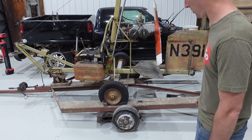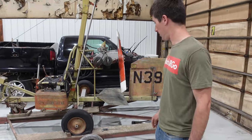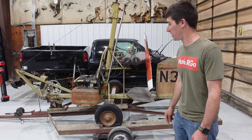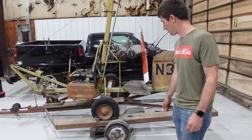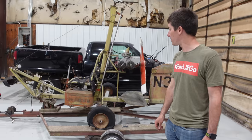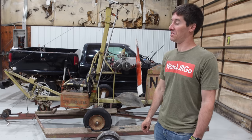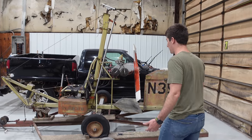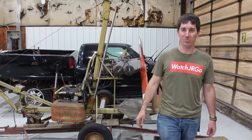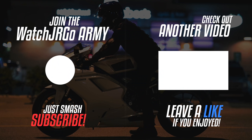Wheels and tires are the main thing we need here because it is just fully stuck — we have to put the jack under it just to move it. We're going to get it though — this thing is so cool. He even had a little ramp he built to guide the front wheel on, because I'm sure he was getting it on from the ground and pulling it up while hooked up to the truck — pretty ingenious little trailer just built for this. All the aluminum looks great — this thing is really very complete. If the gas tank is as good as I think it is, a quick rinse out and new fuel lines and it's going to start once we get the engine sorted. The air intake on this is right here and all the rain just goes in it — so it's probably full of water. Step one should probably be pulling the plugs and starting to soak it with Evaporust. See you next time!